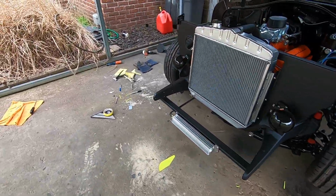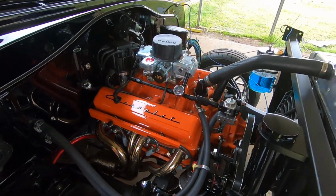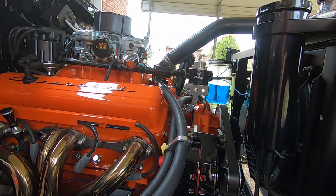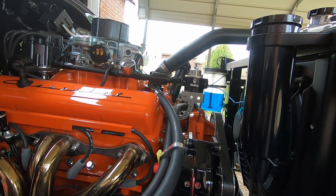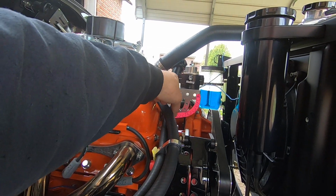But it was a lot of work. It took all day, but I am happy with it. I think it looks kind of cool. I'll end up wiping that whole thing with body filler or putty, probably just some 2-part putty, and prime it out, and then I'll block it real good, and then I'll paint it like a satin black with, you know, automotive paint. I'm not going to put spray paint on it, especially a fuel related part. That piece goes for that.